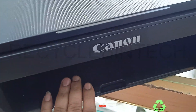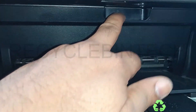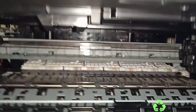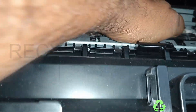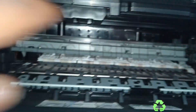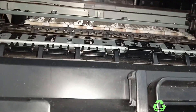First of all we have to check from inside. Open this tray — you can see there is a space there, just press over there and open that cover. After opening, you can use any torch or mobile flash to see inside whether anything got stuck at the white roller. You can see that white roller — check properly if there is anything stuck inside.